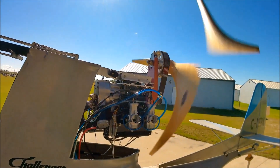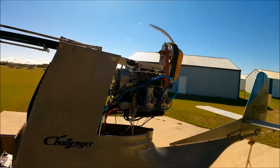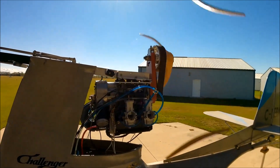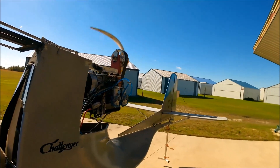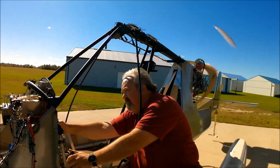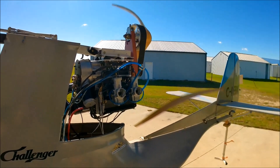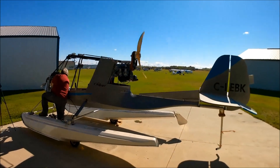So, what is the takeaway from this? The death rattle, which I'd never heard of before, is a real phenomenon. It has nothing to do with the re-drive — it'll happen with the gear drive as well. It'll happen if the engine RPM is set too low. It'll also happen if you drop the throttle really fast and right back down to idle at times. So be smooth on the throttle is essentially what I'm getting out of this. When the engine is idling normally, it idles between 2150–2200 RPM. The idle is set good — I've just got to be careful with that throttle when I back it down slowly, so I don't get that death rattle, which does damage the engine.